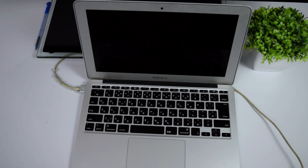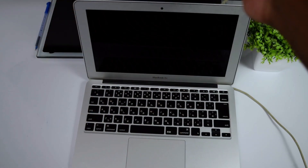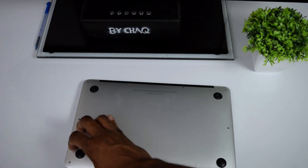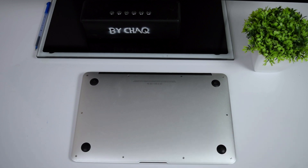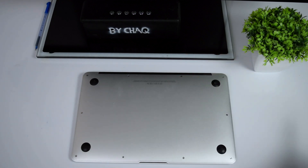If nothing happens, we're going to the last step — step number three — where most people get their issue solved. You're going to unplug the charger from your MacBook, close it and flip it over. What we'll be doing is very simple: just disconnect the battery from your motherboard and reconnect it. Make sure you do not have wet hands.